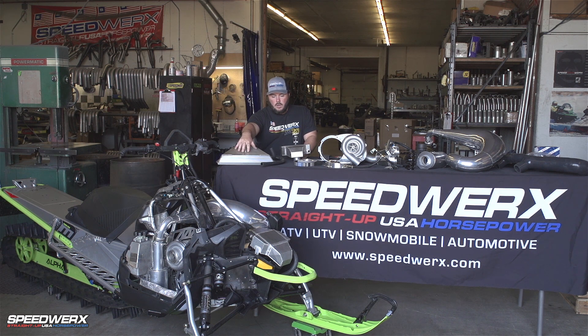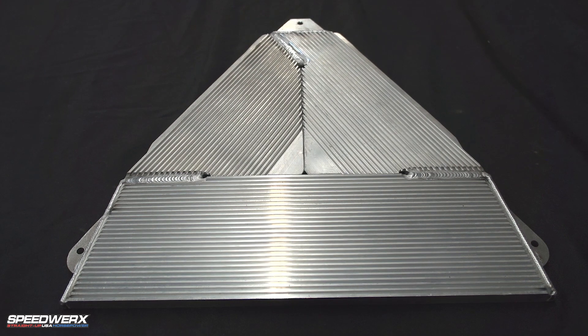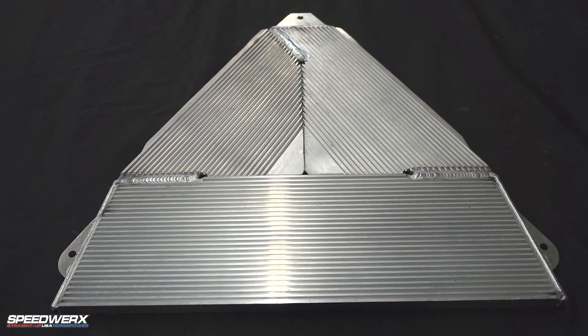It's a self-contained cooling system — the water system is. So all of your water for the water-to-air intercooler setup is just run through this heat exchanger itself. This heat exchanger bolts up to the bottom of the sled and kind of acts as a skid plate as well.